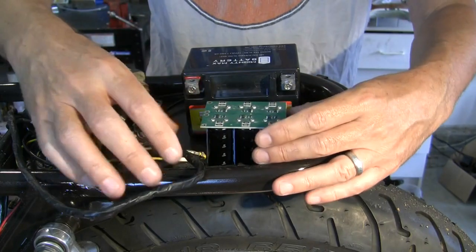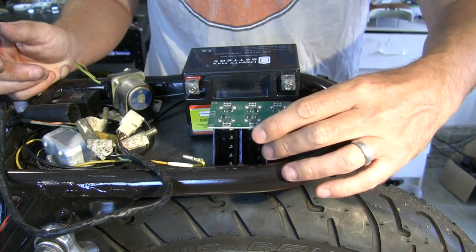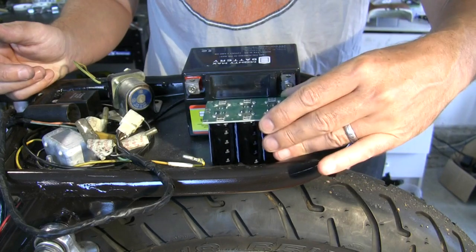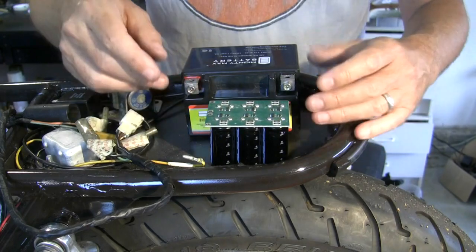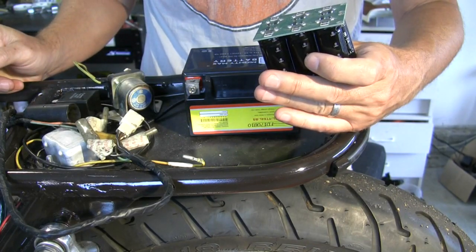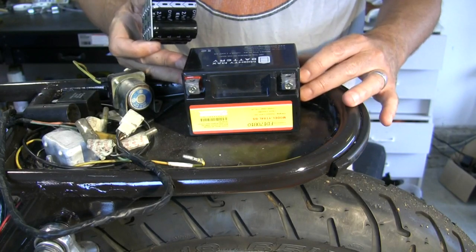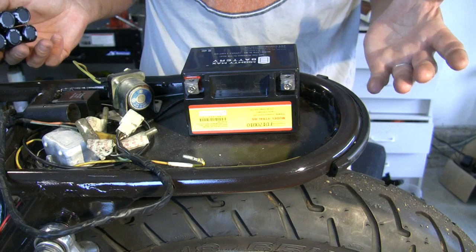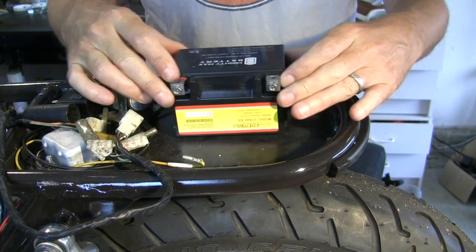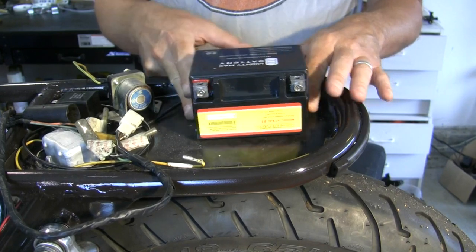I intended to put in these capacitors for just a little extra oomph in starting. These won't hold a lot but I feel like it was a good 75 to 100 cold cranking amps in a short burst — but I dropped this and I don't want to trust that it's going to work. I need to test it, so for now I'm just going to mount the battery without it. This battery may be sufficient because I intend to use the kickstarter for the most part. I want to build two little brackets so the battery will sandwich in and won't slide forward and backward.